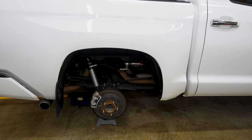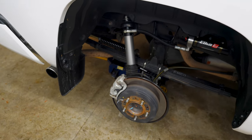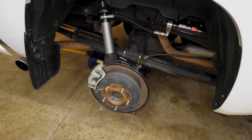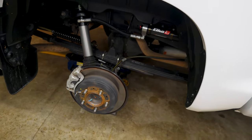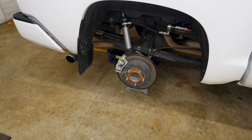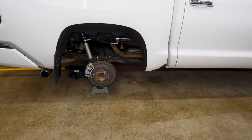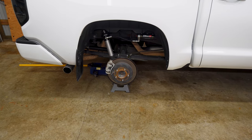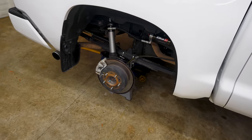Down the road I may look at getting a different hitch setup, but I'll likely still keep the RAS kit. I've gotten used to the spring rate and I like how the truck rides just a half inch higher in the back. I think it makes the leaf spring and suspension a little more active - that's why they call it road active. It handles a bit better, tows better, corners better. You will notice a slightly higher spring rate - a little more firm over speed bumps and city driving. This truck also has E-rated Toyo AT3s, not as soft as the factory P-rated tires, rated for much heavier loads and towing. That combined with the Elka and the RAS system really complements the truck quite well.